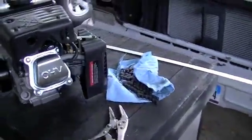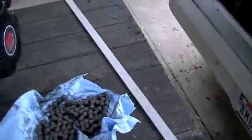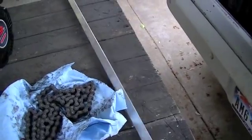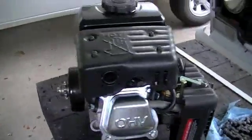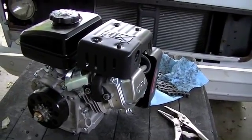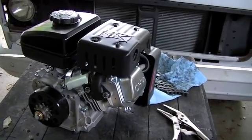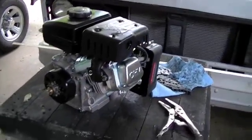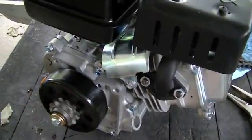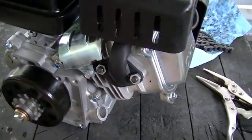I got the engine set up here. I got my old chain — it's pretty dirty — and I got this piece of aluminum, about a sixteenth inch thickness, about three quarter wide. I'll show you how I'm going to use that to get the chain line set up. Because that is the most important thing on any chain driven vehicle — the chain line. If it's off by even as little as an eighth of an inch, it will bind up, causing you problems. You might jump the chain, break the chain, break your clutch mechanism, even bend the output shaft. And if you bend that output shaft, then your engine is basically toast.